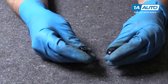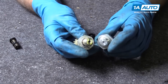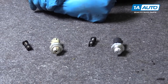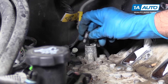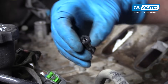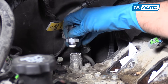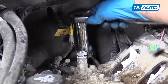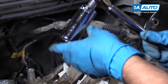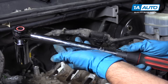The screen — if you look at the screens, they're the same design. Everything looks the same, the threads are the same, the gasket is the same, the connector is the same. Get yours from 1AAuto.com and you'll be ready to rock and roll. Before we install the sensor, we're going to install the screen. Just line it up in the hole — make sure you do it with that screen going down, the top part is open. Push it down with your finger and then take the sensor and start threading it in. I'm going to start tightening it with the ratchet and then torque it once I get it snug. I'm going to use a 1 and 1/16 socket and this torque wrench and torque it to 26 foot-pounds.